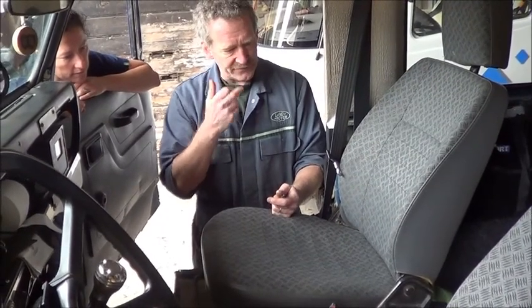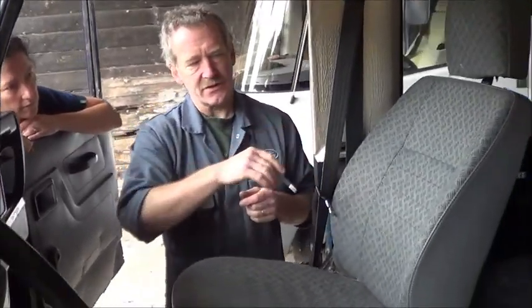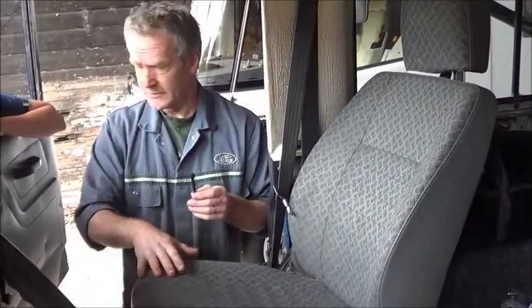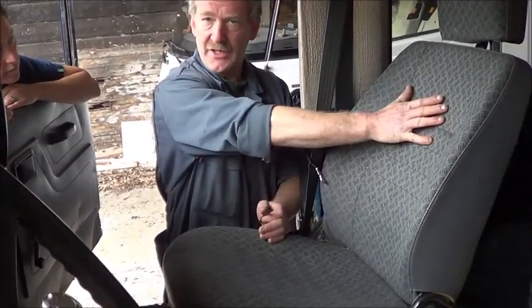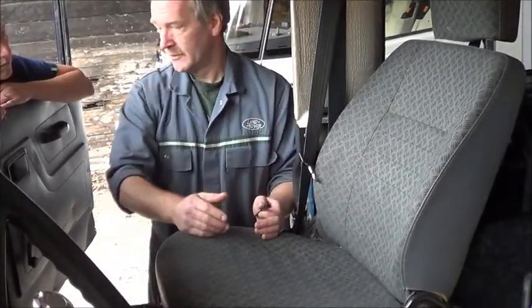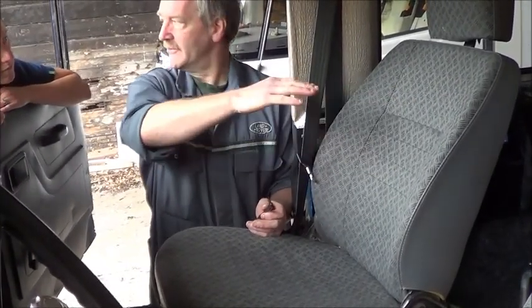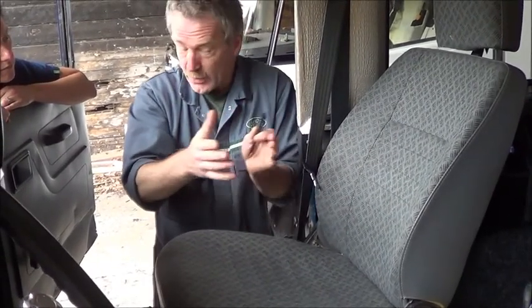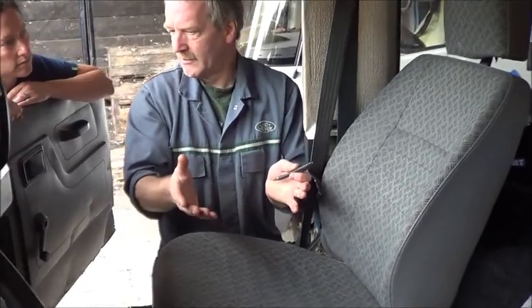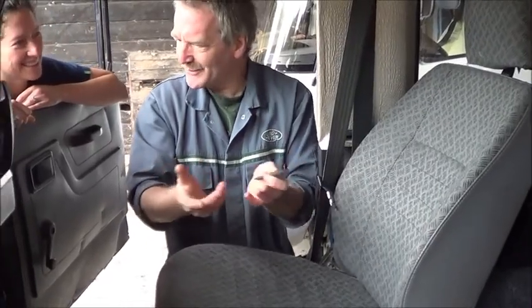Okay. So, and again, the seat back should be solid. There is a rule for the people with the older Land Rovers where the seats are the 2-piece seats. So where you don't have one frame, but you basically have got a cushion there and a cushion here, and then it sits on the bulkhead at the back, like my lightweight. Then the rear seat ones should be fastened to the bulkhead. Normally they've got a little leather strap, and that's enough. All it says is that it has to be anchored to the vehicle. And anchoring it to the vehicle with a little leather strap that is this big actually passes the regulations. It is bizarre, but that's what it is.